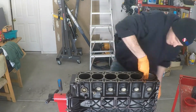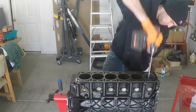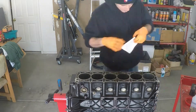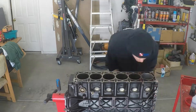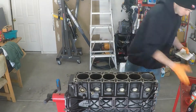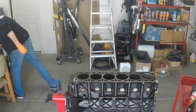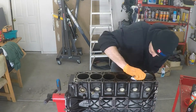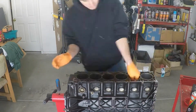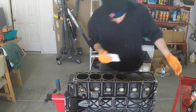While I'm honing, I'm keeping track of roughly how long I'm honing each cylinder for. I'm making sure to drill at a speed and move up and down at a speed that creates 45-degree angle grooves, so that we get a good cross-hatching inside of the bore. I'm also making sure that I am staying straight up and down when I'm going in and out — you don't want to go in at an angle because you can cause tapering inside of the bore, and that's very bad.